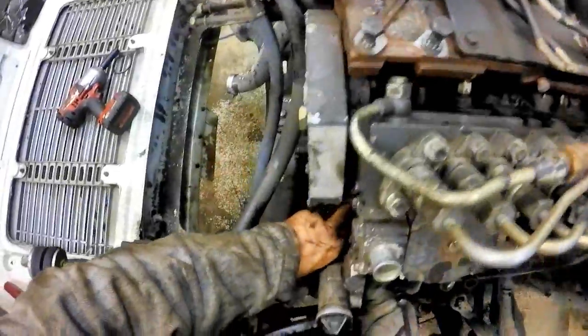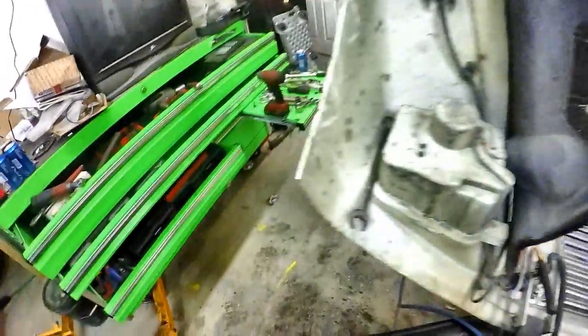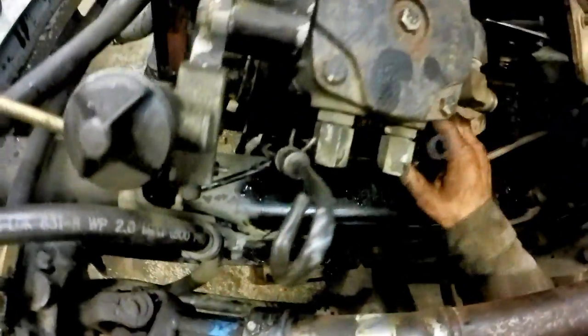Alright, so we got the power steering suction line and pressure line off. Air governor line off. Oil feed line going to compressor. Climb under it. There's a support bracket here holding it on. See what all we gotta do to get that off. Let's see if they jerry-rigged a different one. No, that's not a factory bolt there, so they've had that one off, obviously. There's only two mounting bolts, and the gear will come through the housing so it can stay on there.